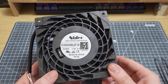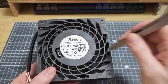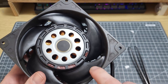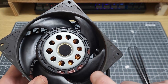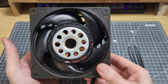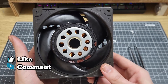There's one other thing I want to say about the fit and finish and build quality. It may look like this fan is just your typical kind of matte black plastic, but this is a solid metal fan — it's very, very heavy. The tolerances, in particular at the edge where the tips of the aerofoils meet the inside of the frame, I've measured it and it's very close to half a millimeter. So let's have a look at what happens when we power this up and see what the top speed is.